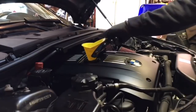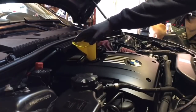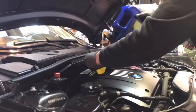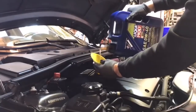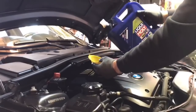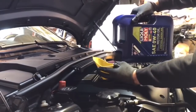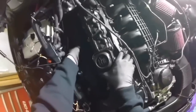For longevity of your BMW you're going to want to use a high quality oil. I'm using 0W40 because it's winter, and I'm using Liqui-Moly because it is a high quality, high performance oil for German automobiles like the BMW. It's 6.8 quarts total to fill up, and I change it every 5,000 miles. Here I'm just topping it off because you will need two different jugs.